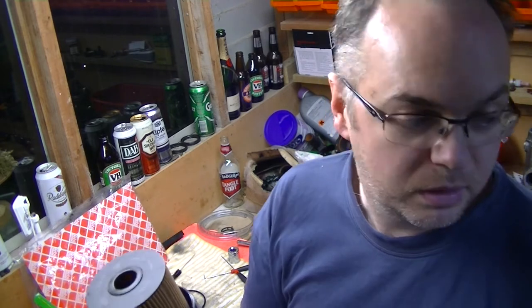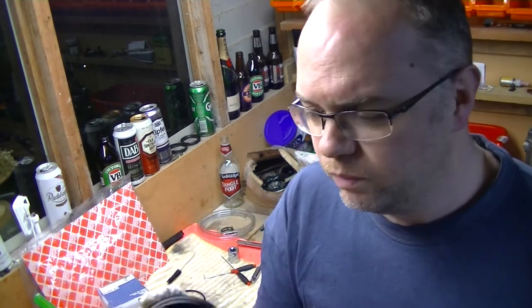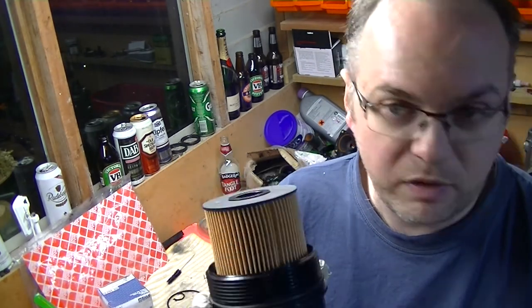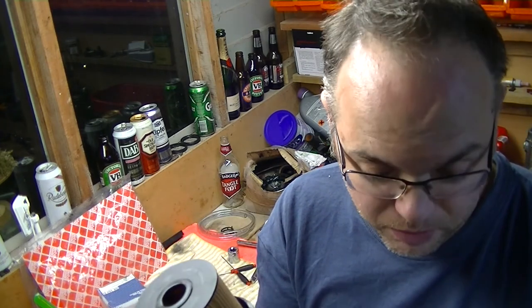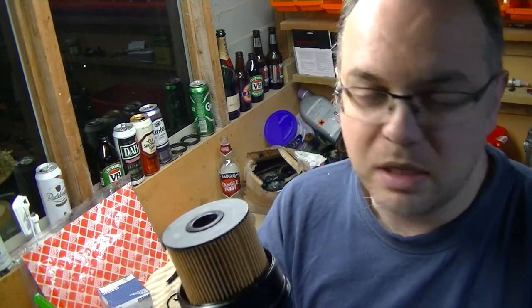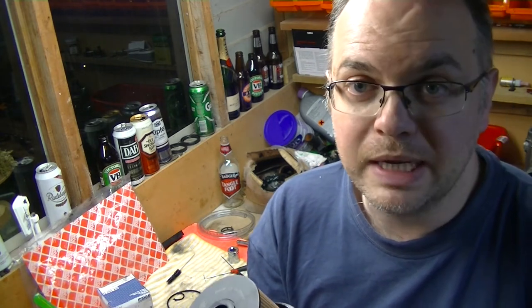VR6 — not a lot of room, you can't see it on the camera, but I'll try and give you an after shot of all the work I've just done, hopefully sorted out the oil leaks. One of the reasons for doing this — I've just replaced the driveshaft oil seal and I started noticing I was still getting drops of oil on the floor. I was thinking my oil seal was foobarred again, but I don't think it is. I think it was just a combination of a couple of little engine oil leaks, this one being the main one causing the problem. Time will tell but I'll give it a good clean and see where we go.